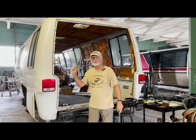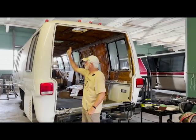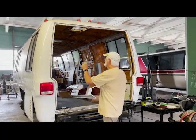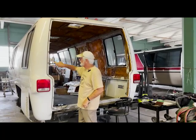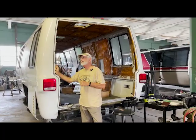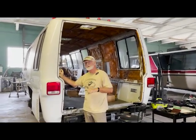Now, there's a number 3 Phillips head on the end of that. Kind of a decorative looking thing, right? Well, they rust. So over the years, you'll see rust coming off of them, or you'll see somebody put some body filler on it and tried to cover that whole seam. Well, you can't do that because this is the body structure. The hatch, and right here, we're gonna put a picture into the hatch. The hatch is screwed onto it and it's floating. So if you try to fill that or put filler on top of that screw, the screw is into here and it's not moving. The hatch is moving, it will break out. It'll just break out, okay? So you can take this coach apart and not disturb the structural integrity of it by taking the rear hatch off. That's another thing it was designed for. So it's very cool. So if you can take it off, be a good thing, okay?